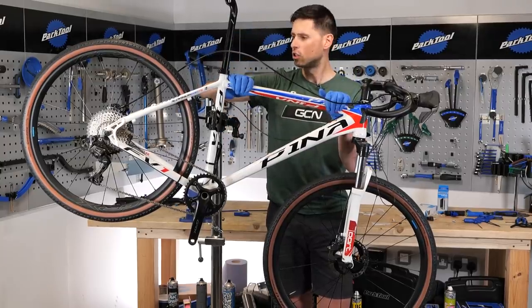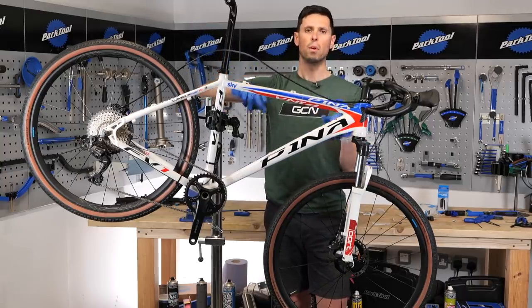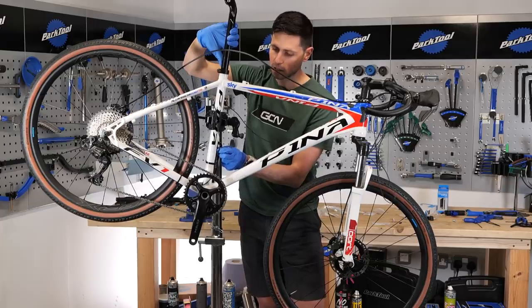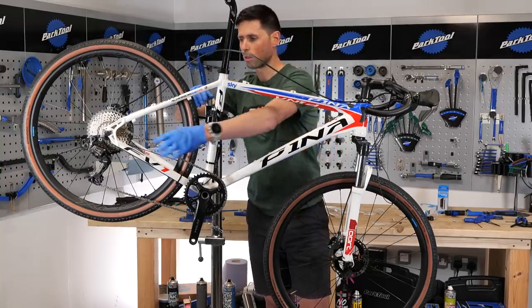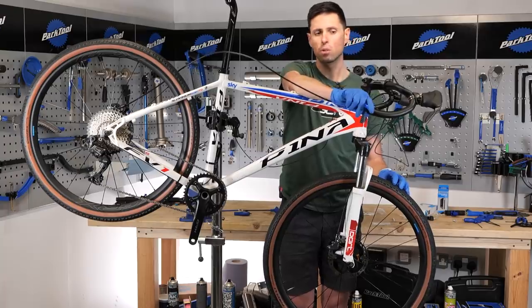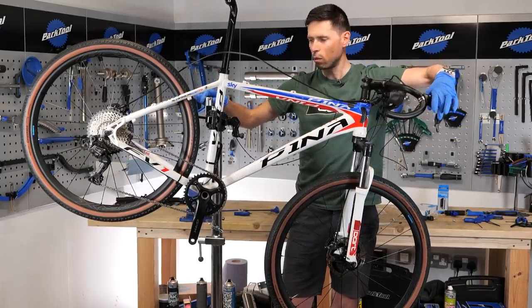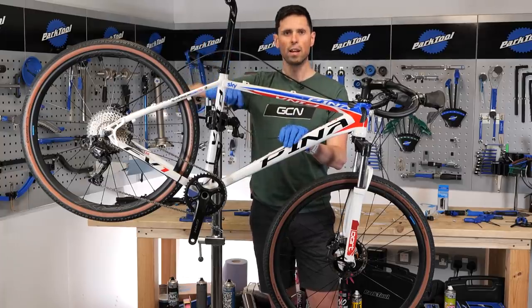A little update on where we're at, because a lot has just gone on over this build. Although it looks like a complete mess with all the hoses and Di2 cables everywhere, we've made really good progress. The battery for the Di2 is inside the seat post — I've used the bottle cage boss on the seat tube, which I drilled out slightly to allow the Di2 cable through. We've got a junction box, and I'm routing most of the Di2 cable externally, keeping it neat and tidy with zip ties. That runs through to the rear derailleur along the top tube, and we've got a Y-splitter cable going to the shifters, with a junction box in the bar end. The brake hoses are all connected and I'll need to bleed those — that'll probably be the last job. But so far, it's actually looking like a bike and we've got working gears!